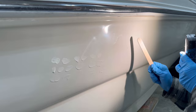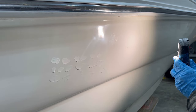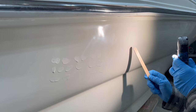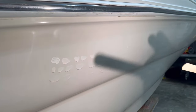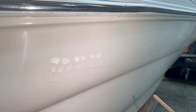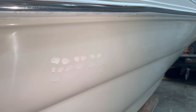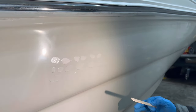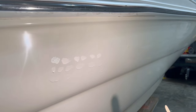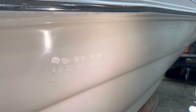I've got this one right here — that was my last final test spot. Between these two colors they are pretty close. This one I had to go a little bit more black because it had too much red in it. Keep in mind, even if you have a 100% perfect match, it will darken a little bit if you don't catalyze correctly. Different patch aids, different wax additives will change color during the cure, especially your reds and your blues. For this one, since white doesn't change too much, I'm going to shoot it with one-to-one Duratec and catalyze it probably 1.8 to 2% range and let it cure for 12 hours.